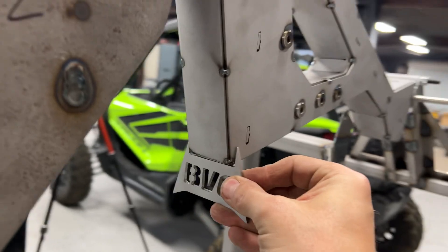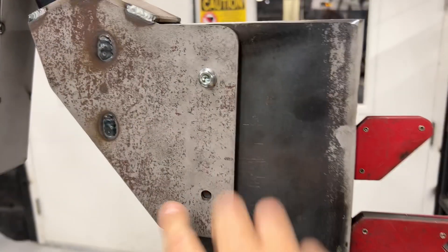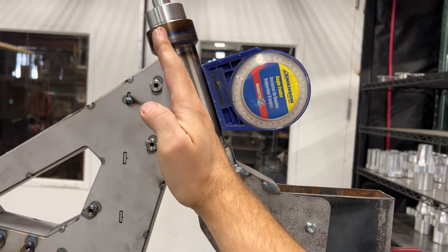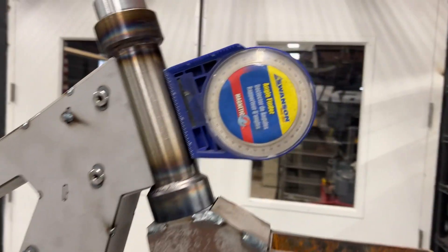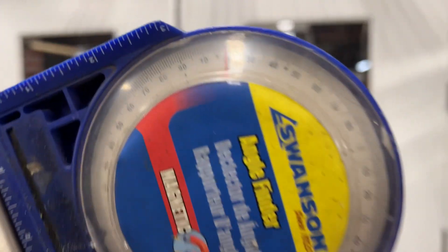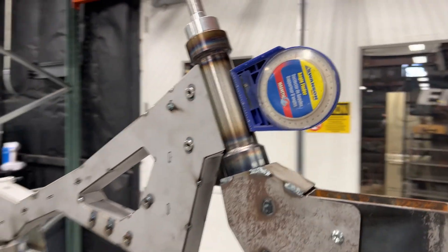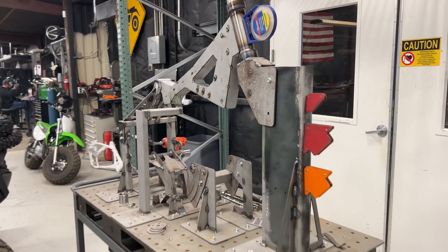Here's a quick little preview of the front gusset that I already cut out. Right here you can see we have some adjustments — I can rotate the head tube for different frame designs if we want to go with a longer wheelbase or a shorter one. It really just comes down to what kind of riding we're doing, from motocross to flat track to even desert racing. More or less, it's unlimited now. Making our own frame is kind of the ultimate goal, and we're heading that direction.